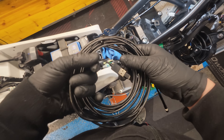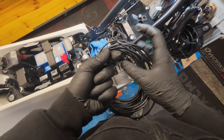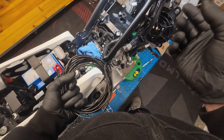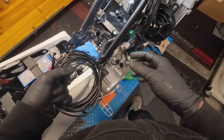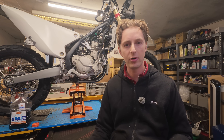There are some wear marks on the exhaust side and intake side just from the piston going up and down. Since it didn't consume any oil, I don't think it's anything really deep — just normal wear marks from the piston skirt. That's usually what I see on a single cylinder that has been run for a while. Engine videos are not really flashy, but if you watch this you see how I convinced myself that an engine is running good or not.